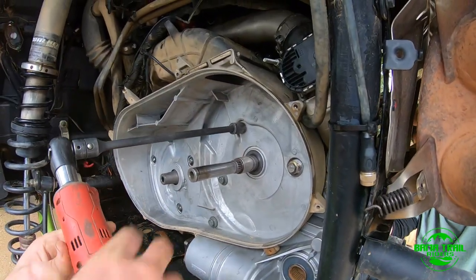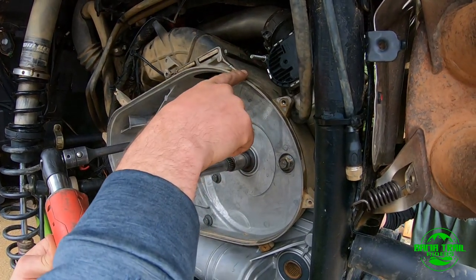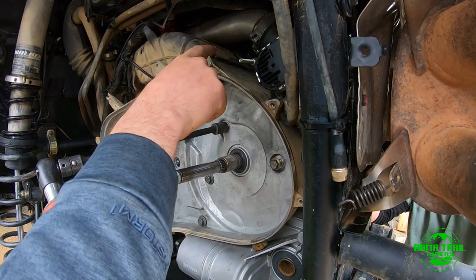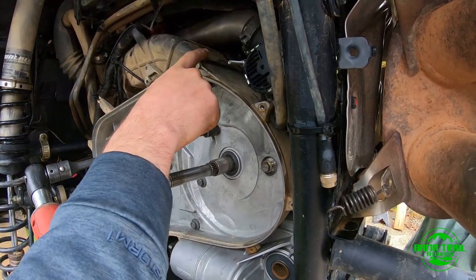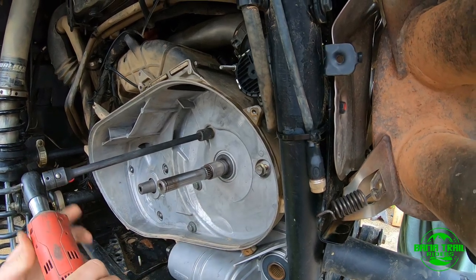But we're gonna tighten these 2 bolts right here that connect to the top side of the transmission over there. One that Lucho is about to show you is behind the thermostat house, and it's a pain to get to. And you have this one right here. It's pretty simple to get to. He's on that one. So, which one are you on?